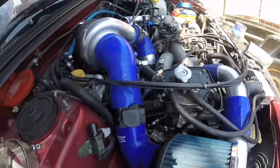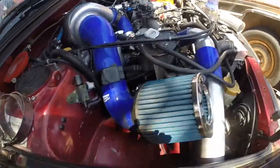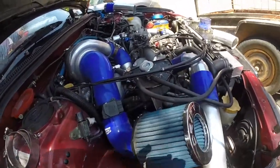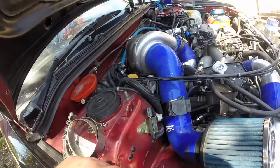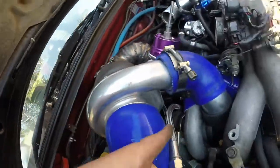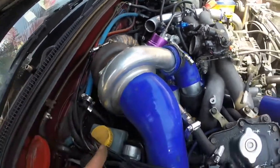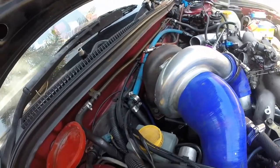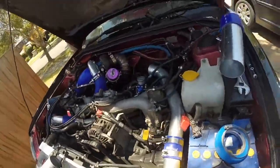So I'm not too concerned about that — I'm going to carry on with the intake. I've got the sensor now pre-turbo. Very dirty air filter that needs to be changed — that might go up against the bonnet but yeah, all good. This waterline will probably go across to the top one, daisy chain from the top one down to the bottom one. Oil feed will come up and around to here. Still got to work out the oil drain — haven't even thought about that yet. But yeah, got all the intercooler plumbing done except for on this side.